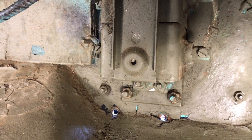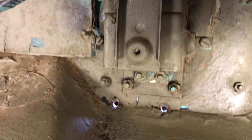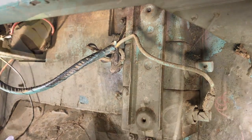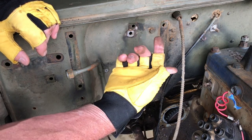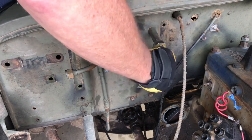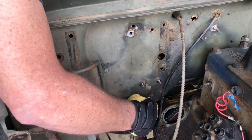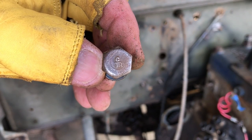The filterette is located on the firewall underneath the passenger side of the dash. I've got three bolts remaining on it at the very top corner — in the previous video one bolt was going through a suppression strap that I already removed. I like to take the hardest-to-reach bolt out first, so in this case it's the top one, reached way up underneath the dash with the wrench, then the lower two with a socket. For those who like bolt markings, these are a C-over-TR bolt holding the filterette in place.